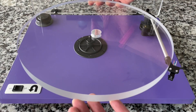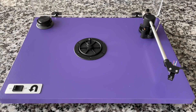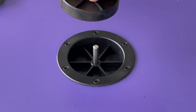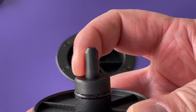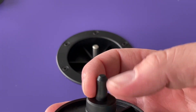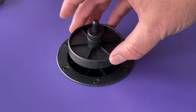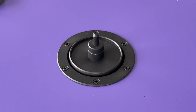I wanted to take off the actual platter itself — it just lifts right off. As you can see, it's just a slice of acrylic, polished front and back. What I want to focus on is this main bearing. They use an inverted bearing system, which is really cool. It does have a plastic spindle, which I'd kind of like to be metal. But what is great is this gimbal system is so well balanced and functional that there's no resistance — this thing will spin for days. It's very solid with no platter wobble. It's an amazing thing — one of the very best things about U-Turn.